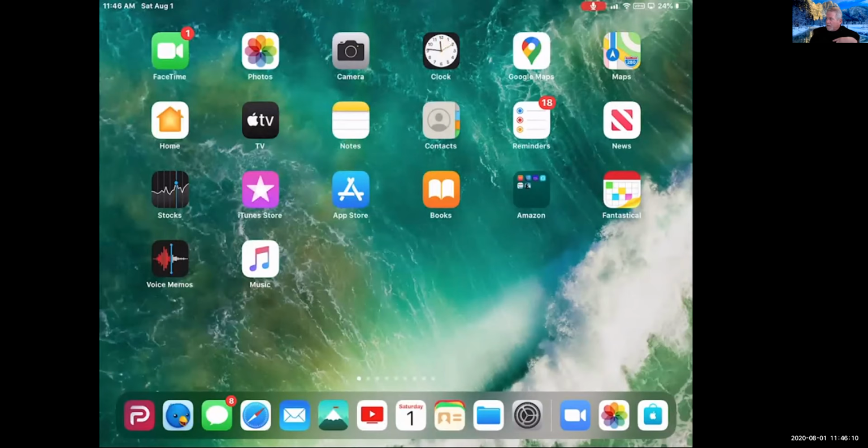Can I have one? Go ahead. Quick bit of help here. I've gone to my iPad and I was trying to do some adjustments on some photos and it's hung up on adjust. Any button I press does not work. I hit done, and nothing happens. So double tap the home button. When you double tap that, you get a carousel of all your open apps, correct? Yes. Take the one that's Photos, swipe it up and away, and then just go back and tap on Photos again. It's just gobbed down for some reason.